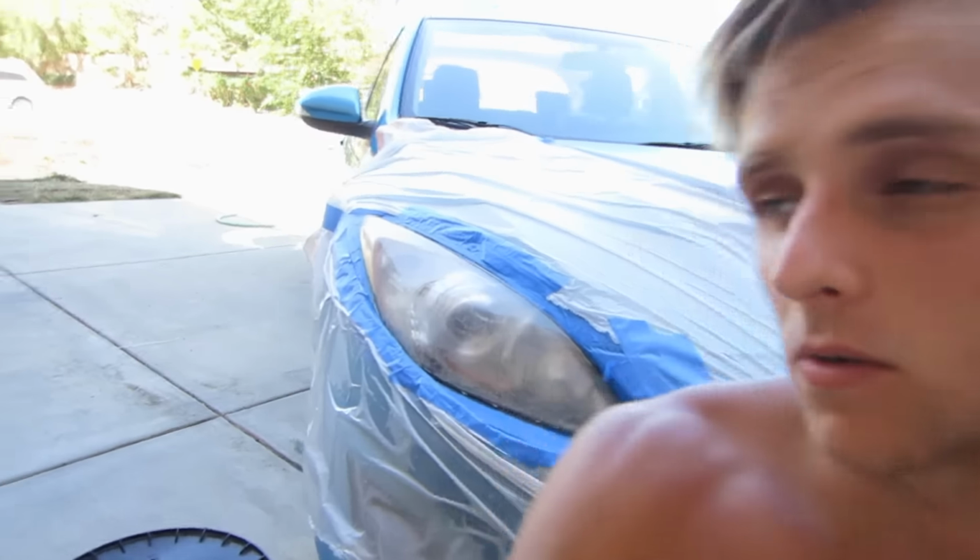Okay, so before we get on to the 1500 grit sandpaper, for your case you might have 2000 grit, and that's what I recommend. But if you have the 1500 or anything close to that, we are going to wash this off before we use that, because if you have sediment like that, it might get stuck into the grit because it's so fine of a sandpaper. So wash it off, then do the same exact thing where you're gonna go in a circular motion first and then end with a horizontal motion.